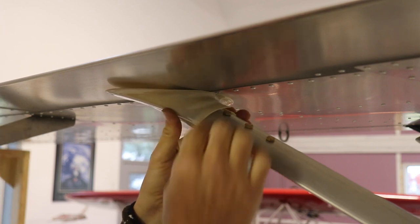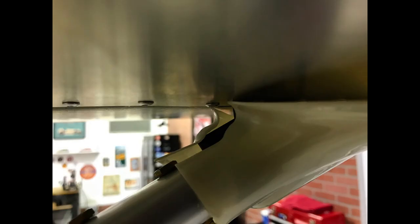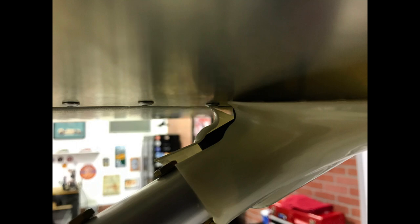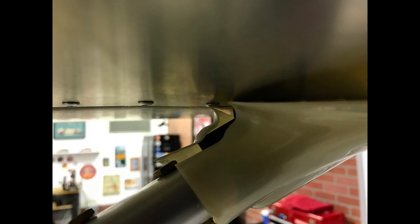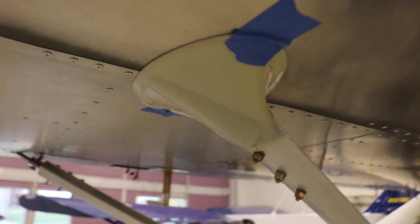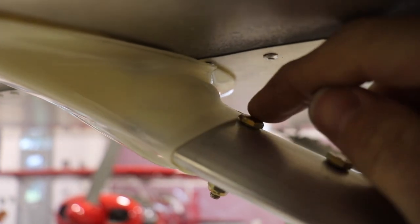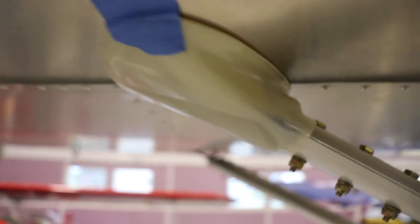I might have to trim the bottom a little bit more to get around the bolt. You might notice there's a bump molded into the fairing, and that black area is the steel fitting, so the fairing has to be moved down on the strut a little bit to fit over that steel part. I'll need to trim a little bit more off the bottom to fit around the bolts. It's been on and off two or three times - just a little bit of trial and error. What I had to do was make a little notch where that bolt goes, as you can see here in this photo. So it's done.